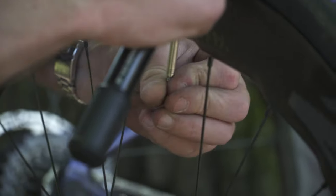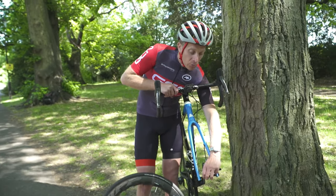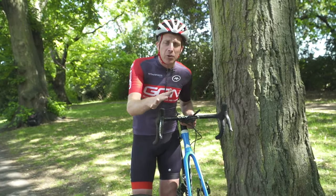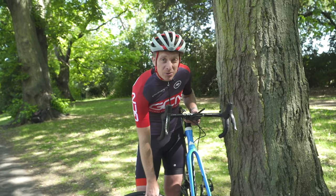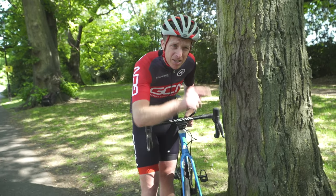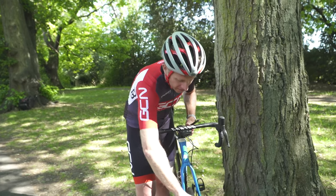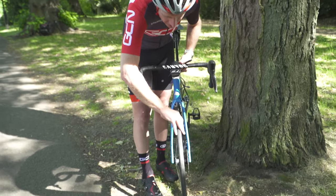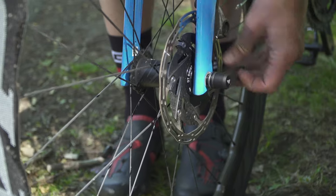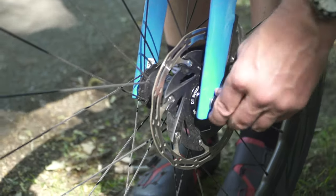The final piece of the jigsaw is to refit the wheel into position. I always like to do this without the bike turned upside down, because the bike doesn't find its natural place onto the axle that way, and the loop of the chain on the rear derailleur can be confusing when it's not in its logical position. On this bike I've got a thru axle, so I'm just going to use the built-in or removable tool to torque that up correctly.